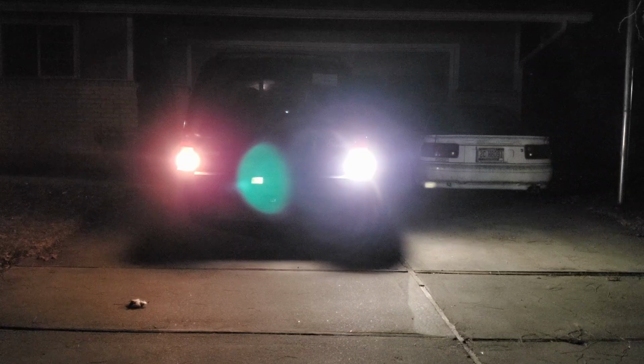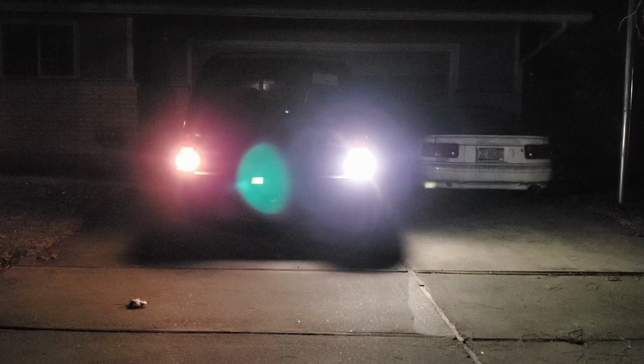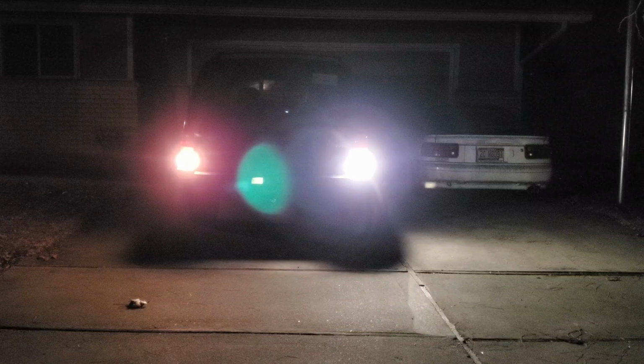And so remember, the reason I'm making this video is to keep people from making the same mistake I did on the headlights. So my recommendations are: don't buy LED headlights unless you know firsthand that they're going to have a good pattern, or that in their sales literature they show you a good pattern with cutoff. Because from the research I've done, there's quite a few LED manufacturers that make LED headlights much like the ones I'm trying to get rid of, with no cutoff.